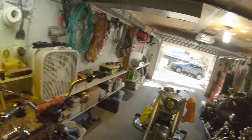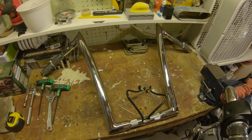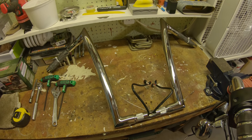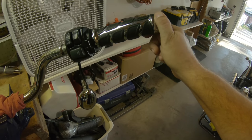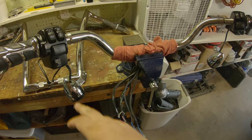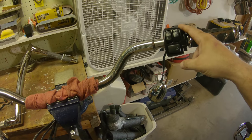The new risers won't be in until next week, so in the meantime I'm going to pull the TGS — throttle grip sensor — out of the old bars, strip the old bar down, and start running wires into the new ones to keep making progress. You can see them there: the 16 inch by inch and a half diameter Dominator Industry Meat Hooks. Going to pull the grip off, get to that throttle grip sensor, and pull the clamshells so we can swap in the chrome switches.